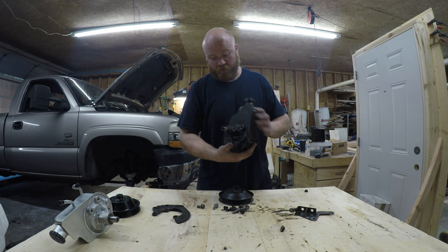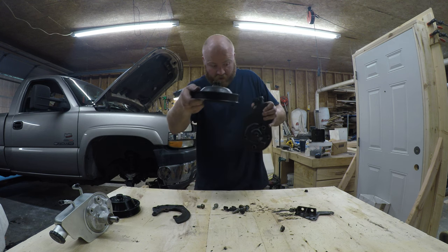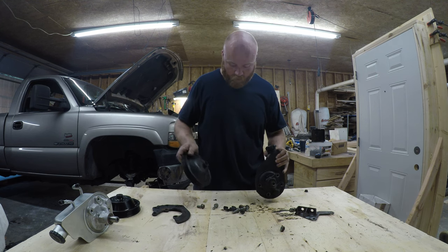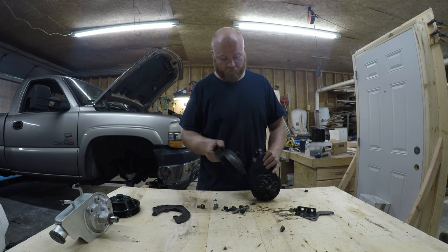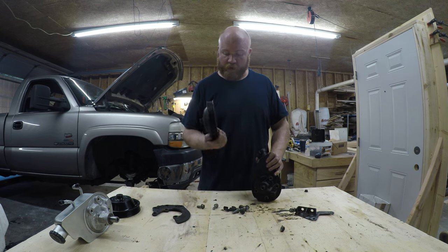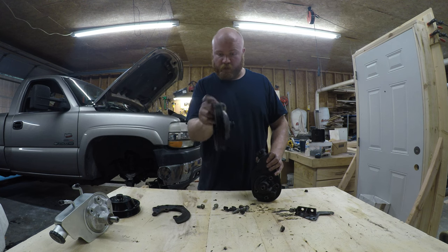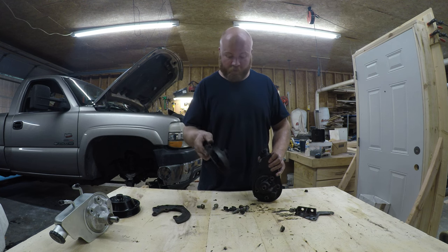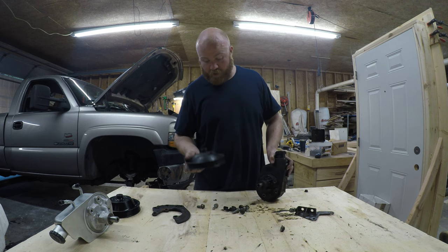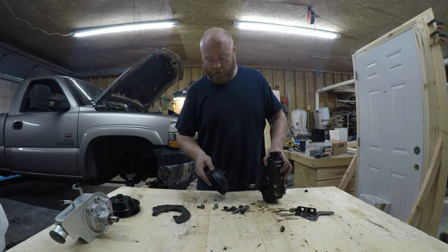On the other end, as far as pulling the pulley off — as you can see by that slit down the middle of both of them — we were unable to pull this off without doing it destructively. We put a puller on it and we started bending the belt ribs and flanges of this pulley trying to get it off. We put heat to it and it wouldn't come off. And even after we sliced it down the middle, it was still hard on the puller to get it off.